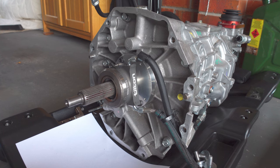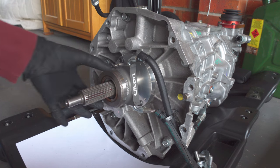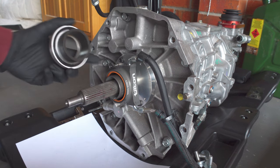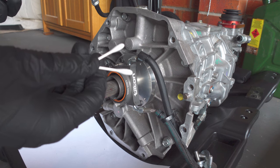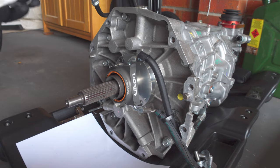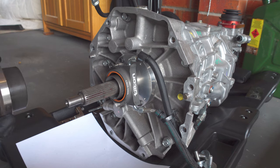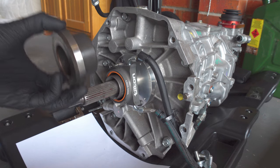The next step in trying to solve this issue is to inspect the bearing itself. Following some advice from Tilton and from Joel Grannis, I've actually removed the bearing from the sleeve, and I've inspected both the actual sleeve and the housing it sits in to see if there was any grit or dirt in there. Long story short, there wasn't - a little annoying to not find what the problem is. I'm still going to clean it out and put a little bit of grease on there to see if it helps make the sliding a little bit easier.